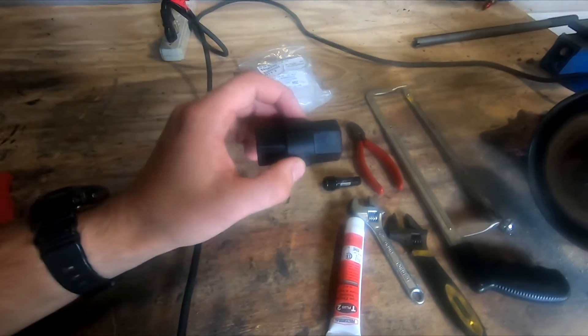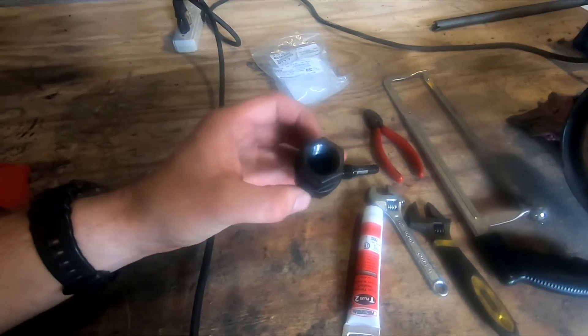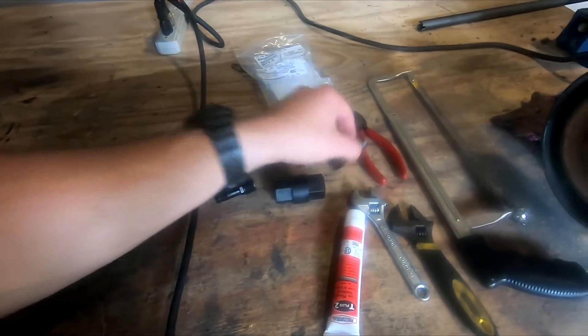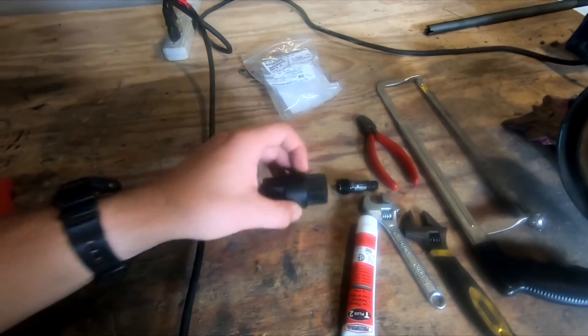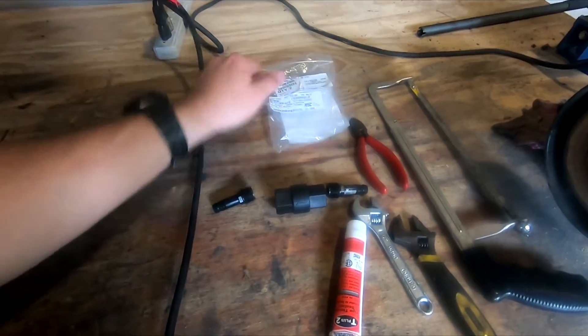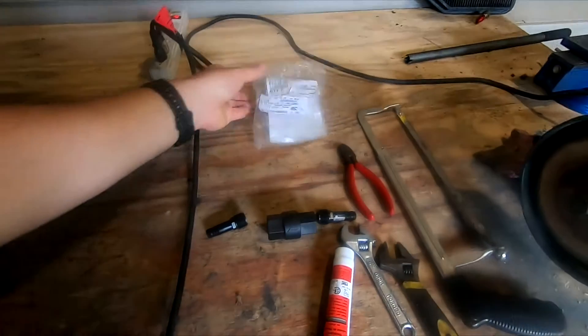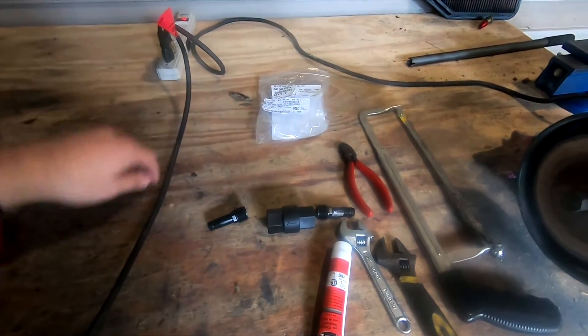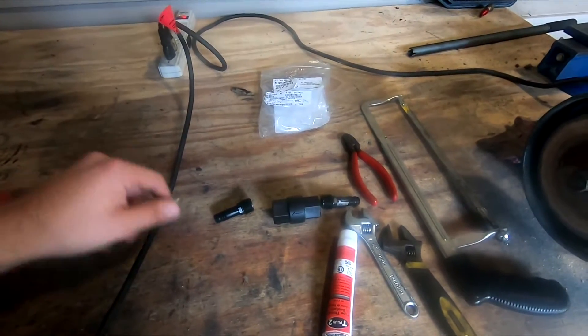Right here what we have is a one-way check valve, and it's half-inch because I have the AirDog 165 pump which comes with half-inch lines that will fit over these connectors. My only concern is this is ABS plastic; however, this is the same part number the guy on the forum used, as you can see right there. So hopefully it'll work just fine — if it gets chewed up, I'll have to switch to something else, but this will at least let me know if there's an immediate issue.